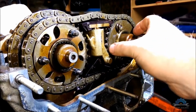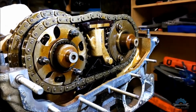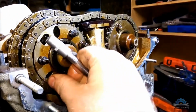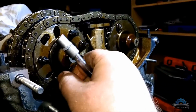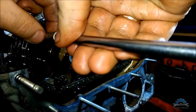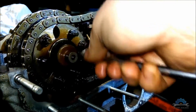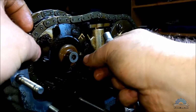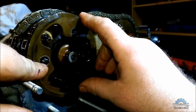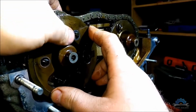Okay, so I installed one of the tension plates, which is on the intake side. It says front, and 3 nuts. Now 3 Torx bolts. Not too tight, just finger tight, because that's going to be torqued down later when you set up the timing. And then the spring plate and the timing wheel with the arrow facing the same cylinder position, that I mean that edge of the cylinder head, same as the first wheel we did.